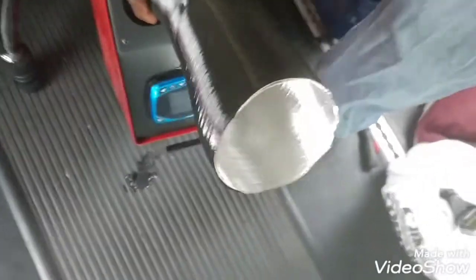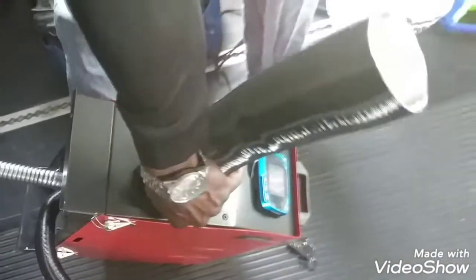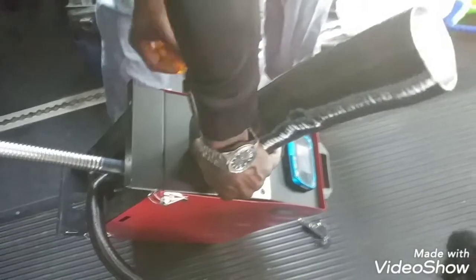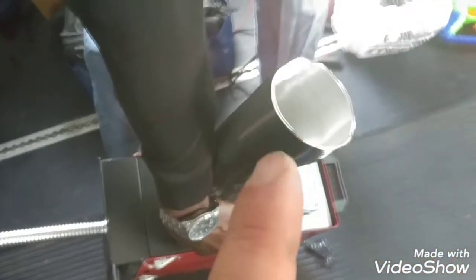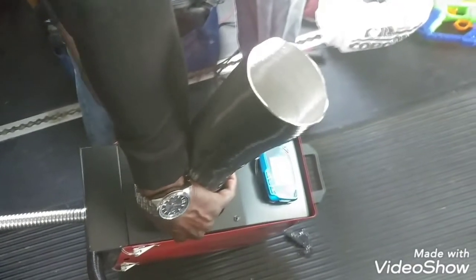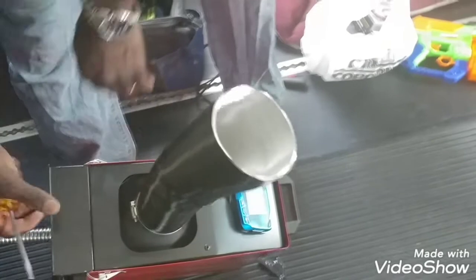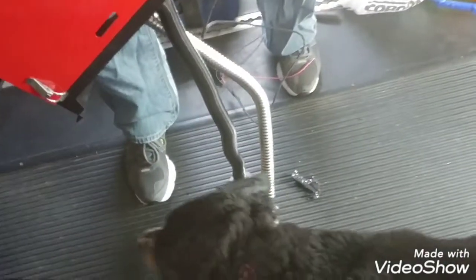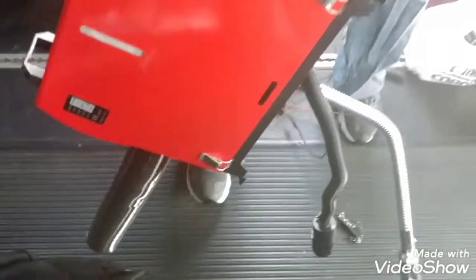This is the air intake — that's where this hose is going. When I install it in my bus I'm actually not going to put that on there because mine is going to sit out in the open. But what this is designed for is if you have cupboards or benches built over the top after you bolt it to the floor, you can connect that piece to a vent hose or ventilation outlet and you never see the device. The exhaust output also goes straight through your floor and out underneath your bus — that's how you prevent carbon monoxide poisoning with this heater.